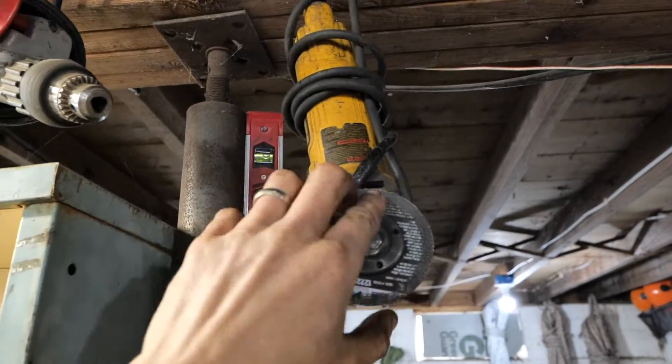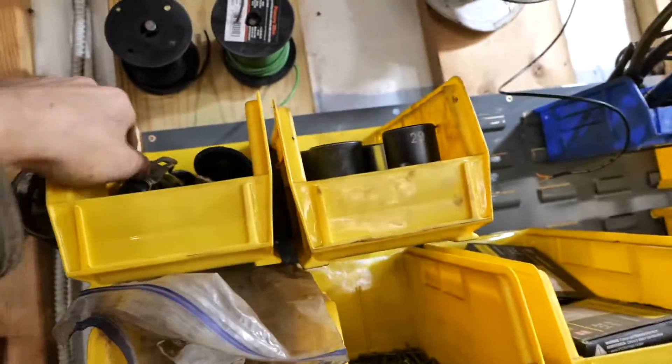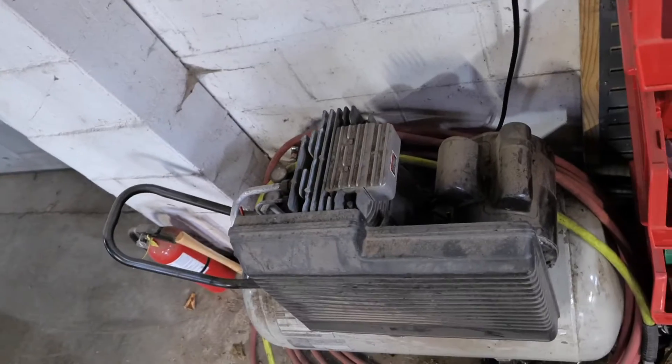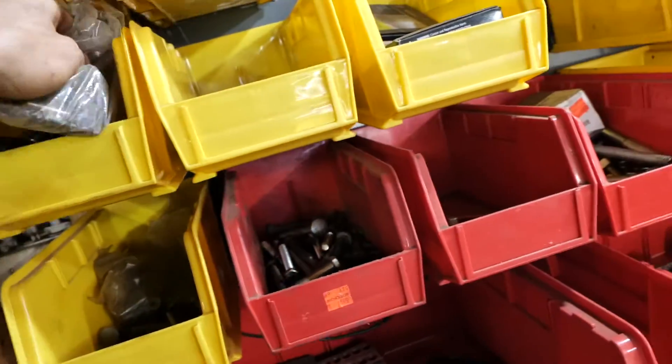Trying to turn the heads of the bolts is basically a dead end — it's a waste of time. There's a reason they put a gap in there so you can cut those off and remove the old manifold. Don't be afraid to pull off the filter housing — it's not that hard. Take out those five bolts, pull it down, make a little mess, and you'll have access to cut those bolts. You can potentially cut from the top with a mini sawzall, but just take those 10mm bolts out and use a four-and-a-half inch grinder. I tried an air-powered grinder but the electric four-and-a-half inch really saved me.